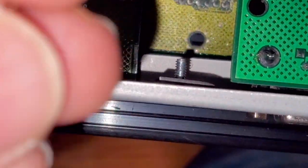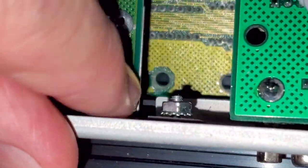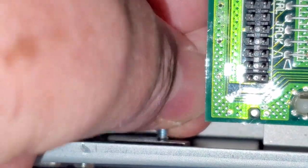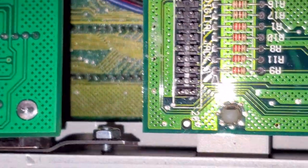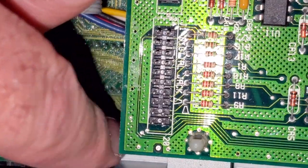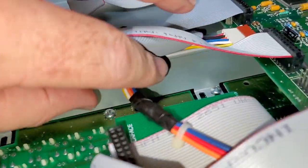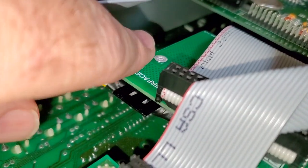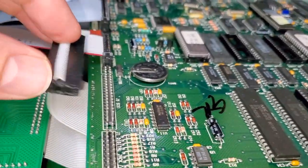So here's what I'm doing — putting this nut and lock washer on that post. What you don't want is to drop it and have it go under that other green board. Since this harness has been in this position so long and really won't lay any other way, I just put some electrical tape around the section that lays on that heat sink. The cable's not touching the heat sink like this, but when it gets flipped right side up, I'm going to let it fly like that. Push the SCSI ribbon down in there.